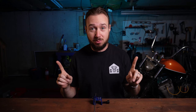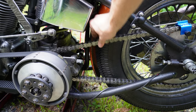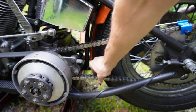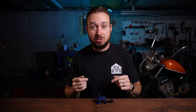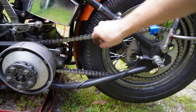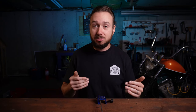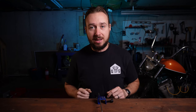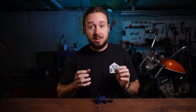I want to mention the two opposing forces we're going to be working with here. One is the chain alignment itself — you're going to be looking down this rod to see if it lines up with your chain. On the other side of that equation is the tension of the chain. As you make adjustments on the axle adjusters pushing them in and out to get this rod lined up, periodically check your chain. You don't want to only tighten the adjusters and then find out at the end that your chain is so tight you can't even move it. Consider loosening one side as opposed to tightening the other to help manage how tight the chain is getting. Go in half-turn increments — once on the left, once on the right — until the chain is at the correct tightness.